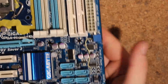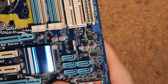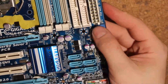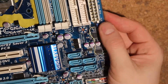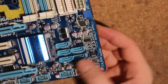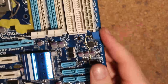In BIOS this board goes down to 1.6 volts, and what I noticed is that chips run colder with lower VPLL. Not too surprising — same behavior on a lot of 1366 chips. On my really good i5 650 I was able to do almost full pot at 1.6 volts VPLL, and only about minus 165-170 with 1.8. So this mod here is kind of the opposite of your normal volt mod — it actually lowers your VPLL below 1.6 volts.